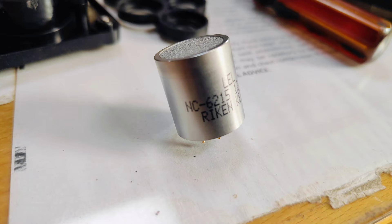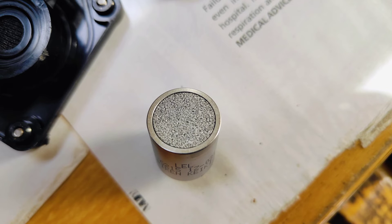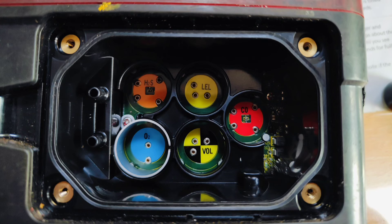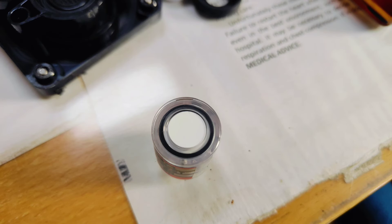There is an H2S sensor, an LEL sensor, and an oxygen sensor. This is the place where all these sensors fit: LEL, H2S, O2 volume, and CO. Once you remove these sensors, try to clean them from the top and also clean their connections.